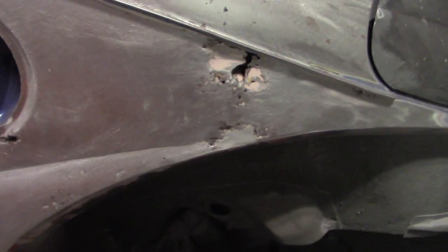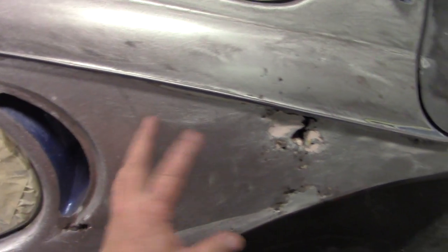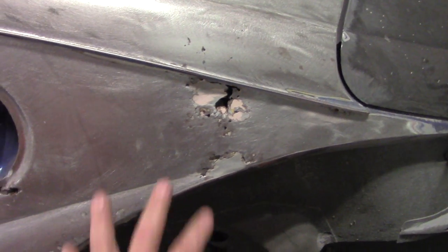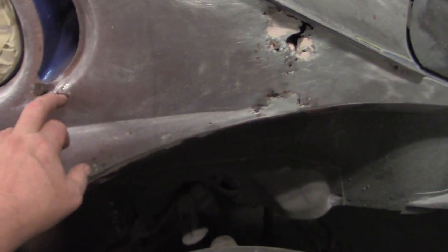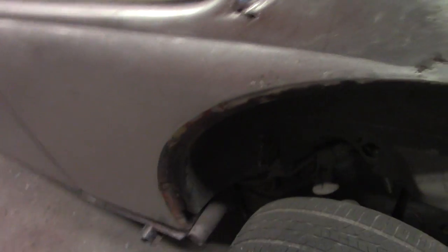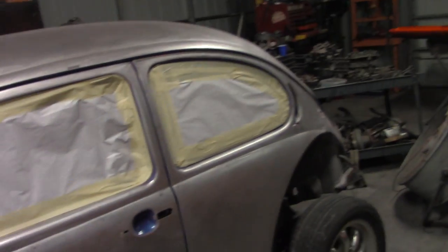This side is not near as bad, but it'll still have to be cut — there's a brace that runs through here and then it's solid foam. I bet there's five pounds of foam in there, packed from down there to up in here, and all that water just soaks the foam down. I hammered and dollied the hood out — it's pretty decent now, and the roof is pretty nice. Got it slapped with a slapper dolly and got most of the stuff out of it. This door needs a little more work and I have to wipe some Bondo here and there, but this is my major project. I'm going to put the rest of the car in some sort of epoxy while I do the metal work so it doesn't get away from me. Been going over it with the DA, need to hit it with some 180, then wipe it with lacquer thinner and clean rags before coating.